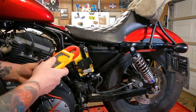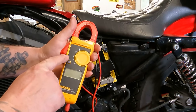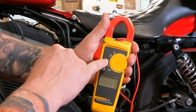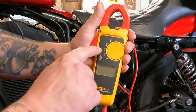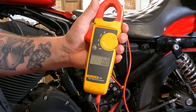Now the first thing we're going to check is the battery voltage. We're going to take our voltmeter and put it on DC. If it's not labeled AC or DC, there's going to be a straight line or a squiggly line. The squiggly line is for AC — that's the voltage in your house. You want DC, the straight line one.